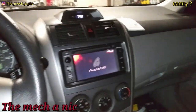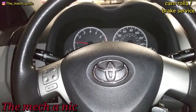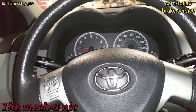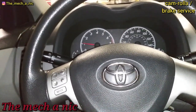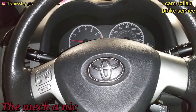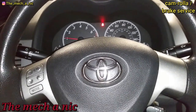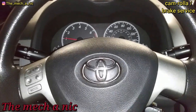I'm in a Toyota Camry or Corolla — it was here for brakes, so I got front pads and rotors done. I took it off for a test drive and it stopped well. Then the owner said she wants to get a brake fluid flush, so I went ahead and knocked it out — bled at each caliper, refilled the reservoir, all that. Took it out for another test drive and it is like a completely different car. It's amazing how something that's quite often overlooked, like brake fluid, makes a massive difference.